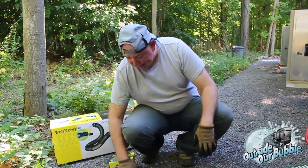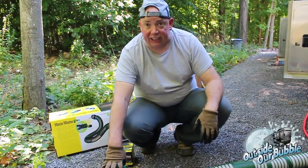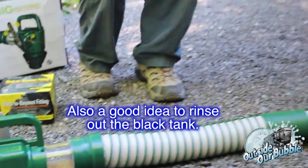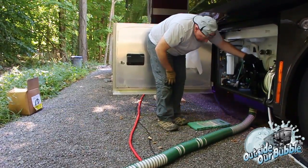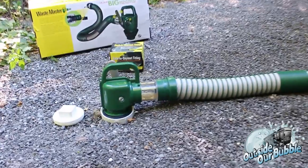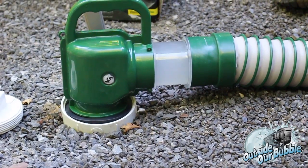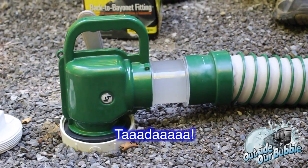So in any case, looking at this, you can see I'm pretty much drained out at this point. Can you see that? There you go. So now we're going to go open the gray tank. So I'm coming over here. I'm shutting the black, and I'm opening the gray, which will flush it all out. So watch that tube down there. Here we go. You'll see the bad stuff come out, as you can see the color. And then look, followed by the clear, which is all the gray tank. So this is getting a nice clean flush coming out of here at this point.